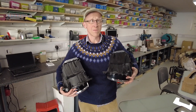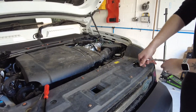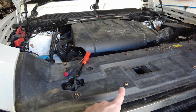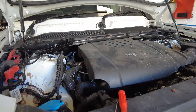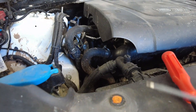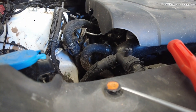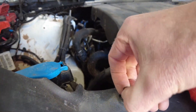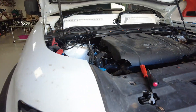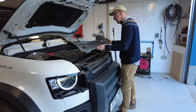Let's get the headlights out. We've got four Torx T30s along the front and two-piece clips at the back where you get a little screwdriver underneath and separate the middle bit out. We'll take all those out and then get the front panel off.